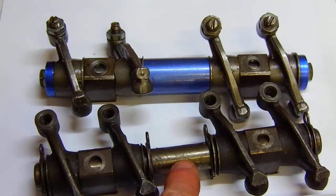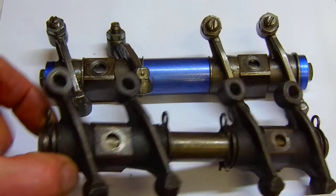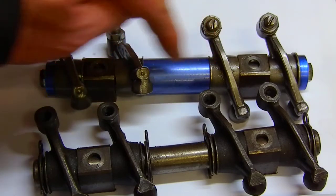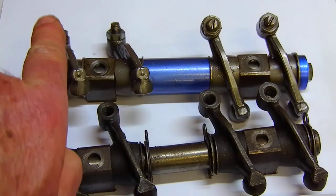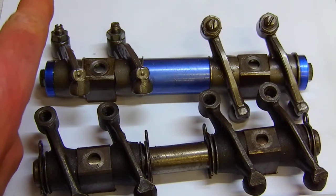This is a solid shaft — the same concept as the other one, except this shaft is threaded on the end and the other is not. This allows us to put a cap on the end and then put shims in to make it a solid shaft assembly. We put shims in different areas to get the geometry correct, staggering the rocker arm assembly over the tip of the valve stem or over the lash cap to prevent it from rubbing in the wrong spot or riding off.